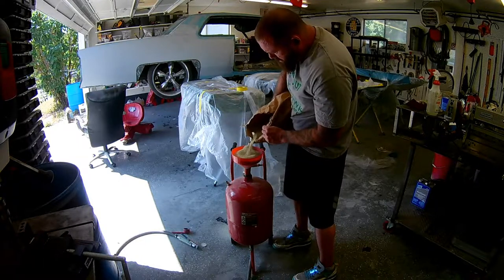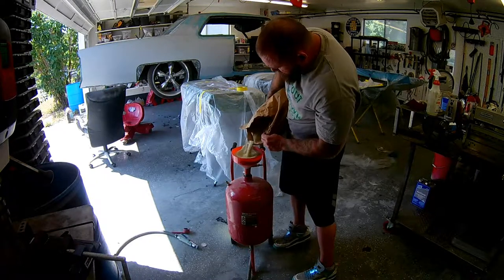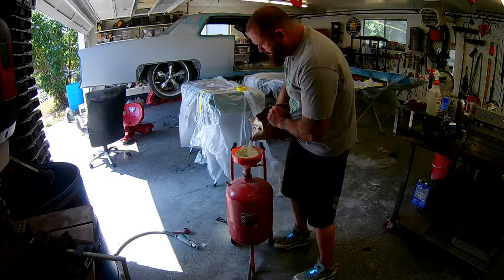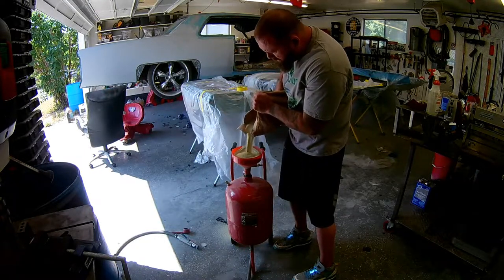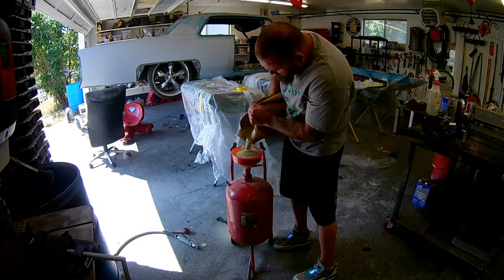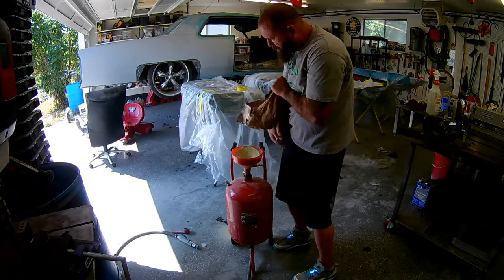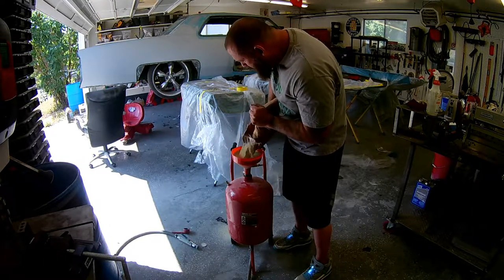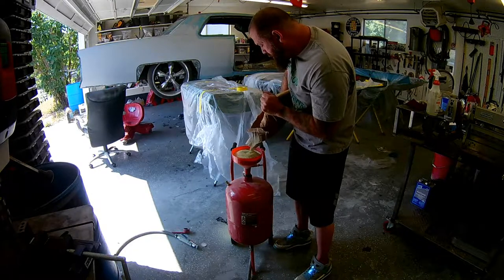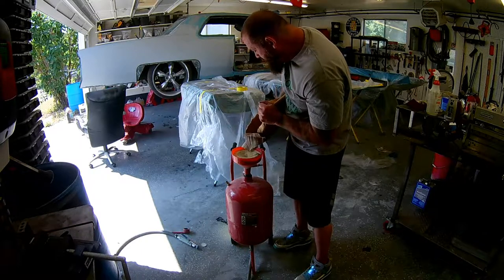You can't keep it all out — you will be blowing and vacuuming it out for a while to get it ready. But this is kind of necessary on the edges of these panels. They had a little bit of surface rust in areas that I couldn't grind out, so this was the way to go. I like to clean the edges of all these old panels with some blast media for grip. That's where you're going to have a lot of your problems — your edges. So I give them that little extra step to get those nice and bright clean, then hit them with the epoxy paint.